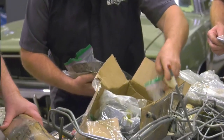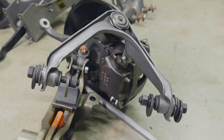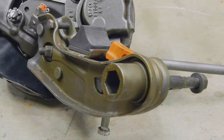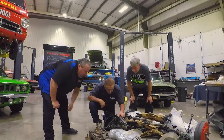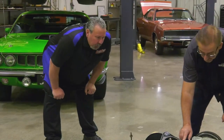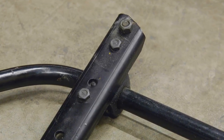We just got it unpackaged. The upper and lower control arm assemblies have been correctly finished — they're just dirty from sitting around. This actually has cosmoline on it — that's why it looks so right. You got your eccentric bolts with a beautiful black phosphate finish — those are NOS. And here's the 70 E-body only shock plate, which drops the shock down lower. You got your front sway bar on here with the correct Highland bolts, and they're going the right direction with the right cap — looks really nice. You got the tie rod end assemblies — they're correct — and your drag link.